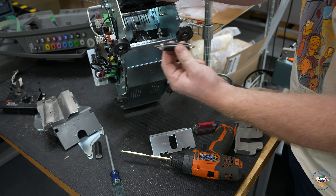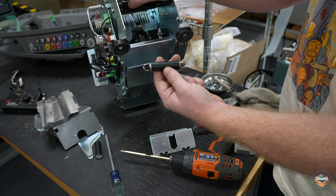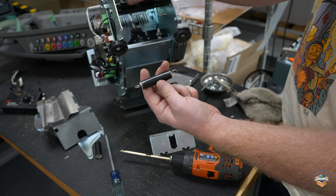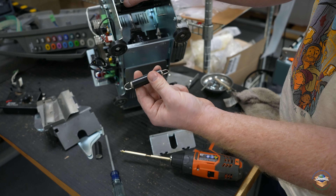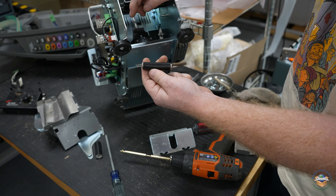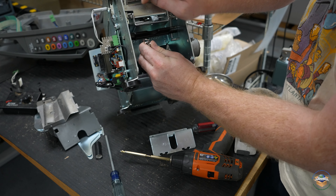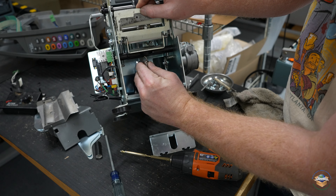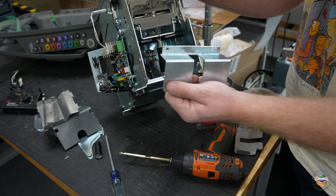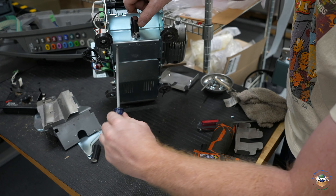Before we put this plate back in, we're going to take our spring and put that in place. Part number for this spring is E555-074-01. If you don't have the little protector on the spring it's not a big deal — the idea is it helps keep the noise of the machine down so that spring won't vibrate when it goes up and down. We've got the cover on ours. Hook it into that lower slot, make sure your blade's down — should be able to do this all by hand — and set it in your lower plate. Now that keeps that blade in place. Take your plate and get that back in.